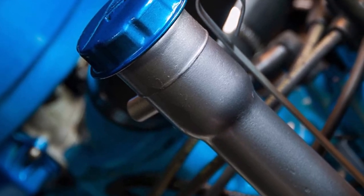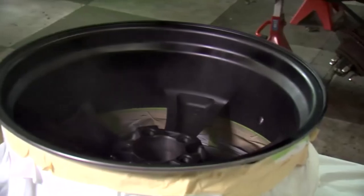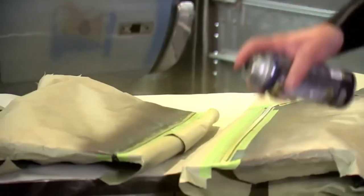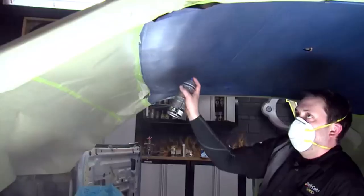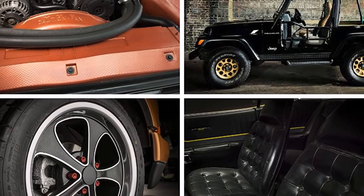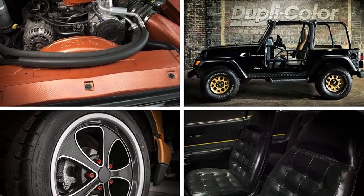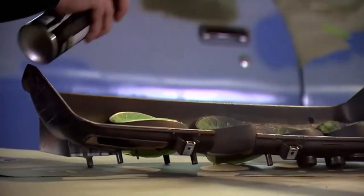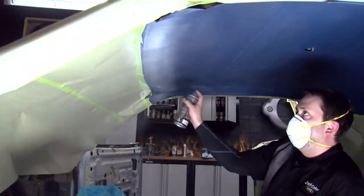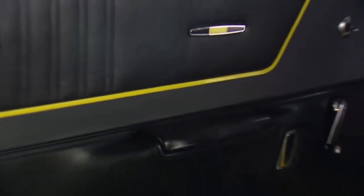There are a variety of color options in addition to red, including bright yellow, gloss black, and gold. The spray can and nozzle are good quality, and the paint goes on smoothly. The paint is easy to apply, and one can go a long way. However, proper preparation is vital for the product to adhere and cure properly. If you don't use a clear coat, the paint can absorb brake dust and fade to a dusty color. It's also not as thick or durable as brush-on paint.